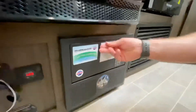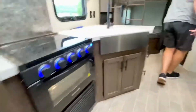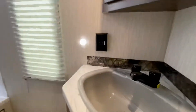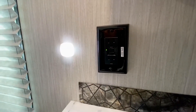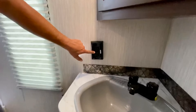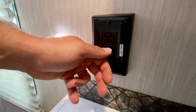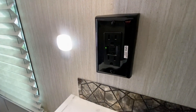One more thing I want to show you outside of this box is going to be the GFI located in the bathroom. If you lost all of your receptacles outside, inside — this reset on the GFI controls all of the outlets in the entire RV. So in the bedroom, outside, inside, kitchen, everywhere. What you would see is the green light would go away simply with it having power from campground or generator. It has to be under a load to reset. Push the reset button and you'll get your green light right back.